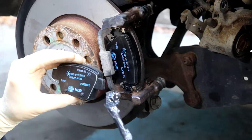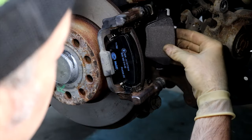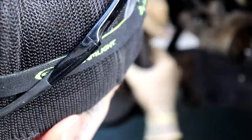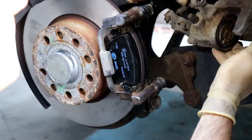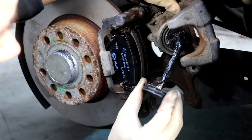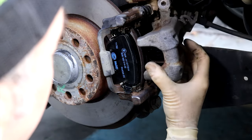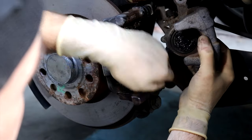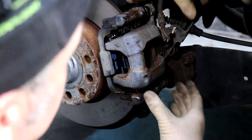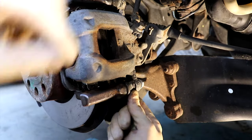Go in at a slight angle and push the pad into place. Same thing on the backside — take our second pad, lube it up, come in at a slight angle, and it snaps into place. Next step: take our caliper and do a little bit of lube on that piston — this is going to prevent squeaking. Since you pushed the piston back, make sure the pads are pushed all the way forward — they're kind of springy with the rubber — then get the caliper into position and take our new bolts and get them started.